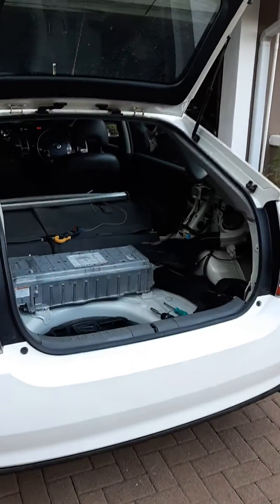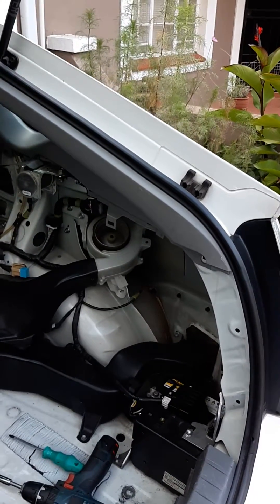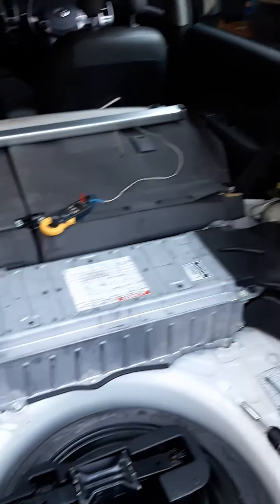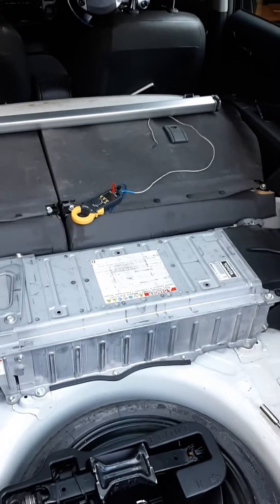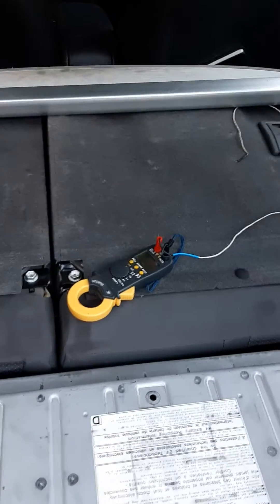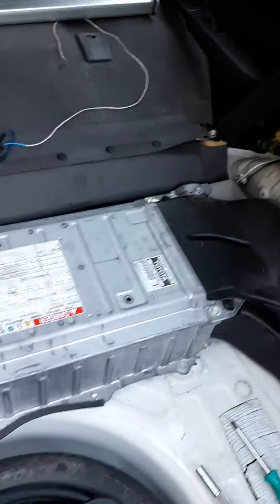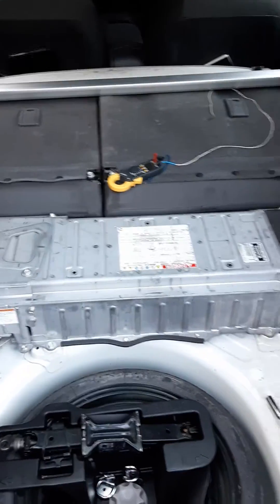What I'd like to show you this afternoon — I wanted to determine whether my fan is actually working. So I've got the car on, switched on, it idles at will, and I've heated up the battery. It's a very hot day, about 35 degrees outside and I've done several trips. I've been on the road all day, so the battery peaked. I used this thermometer sensor which I tucked into the duct here and it measured up to 51 degrees this afternoon inside the battery at the top vent.